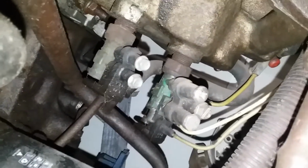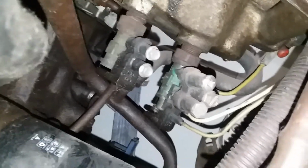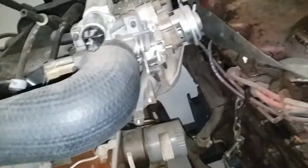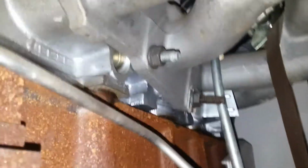But let's see, they always have more temperature actuated vacuum switches or vacuum valves than what they need. So you can unplug those and replace them with coolant temp sending units if you need. I don't think that's something you can do with any of the EFI motors. I don't believe any of the EFI intake manifolds have any coolant going through them. I know the 1.9 EFI high output doesn't. I know the 1.6 EFI doesn't, and the 1.6 turbo I don't think it does. It would be the same as the 83 through 85 EFI, and it doesn't seem to.